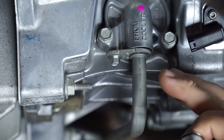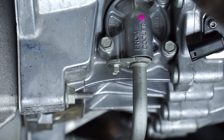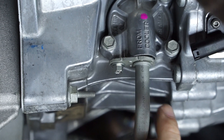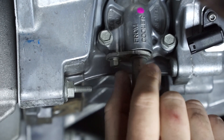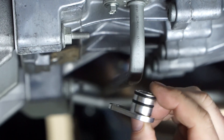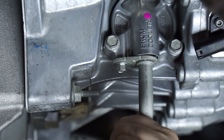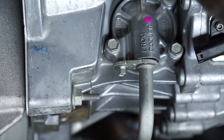It's a fairly simple fix. Obviously the design tolerances and the type of O-ring come into huge play, but it's a simple fix for the customer — and that's what we wanted. There are some kits on the market where the customer is going to have to cut the line back here, and they make AN adapters that go in here and then you have to do a whole new piece of line. We didn't want to do that. We wanted to give the customer something a lot simpler that actually fixes the problem without having to cut the car up.